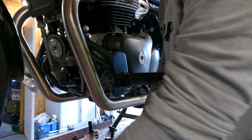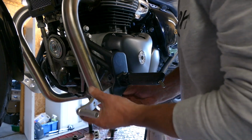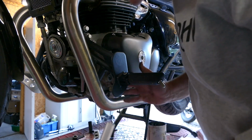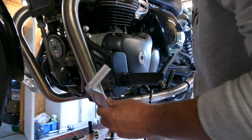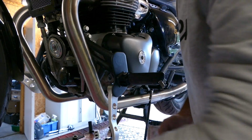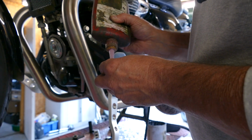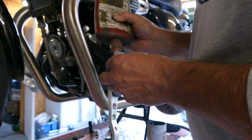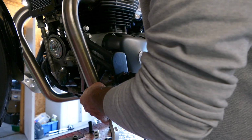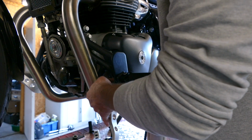and remove the lever. Again, it's important to check that this is a good fit on the shaft and pivots nice and freely. And if you're happy with the fit, just put a dab of grease on the shaft, just universal grease. Pop the lever on. Again, pop some blue Loctite, again just a tiny little dab. Refit your bolt.